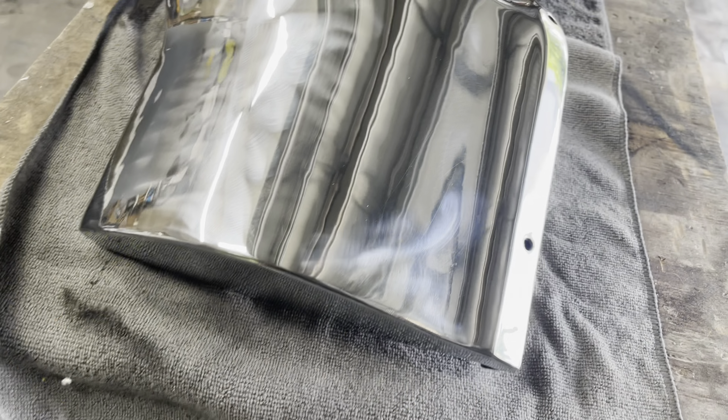These are the parts after a second buffing. The shine actually looks better — it resembles chrome. It's actually what I was looking for when I decided I wanted to chrome these parts out and not paint them, as many other '66s out there. For the final, these are the two front fender emblems, which I've also polished and powder coated to give it a bit more of a different design with the color scheme I'm going with. This is the sour apple green from Eastwood powder coating. From the combination, everything seems to have a much more symmetrical and even look.